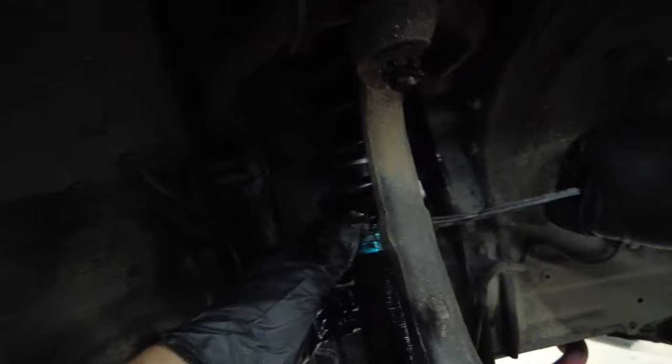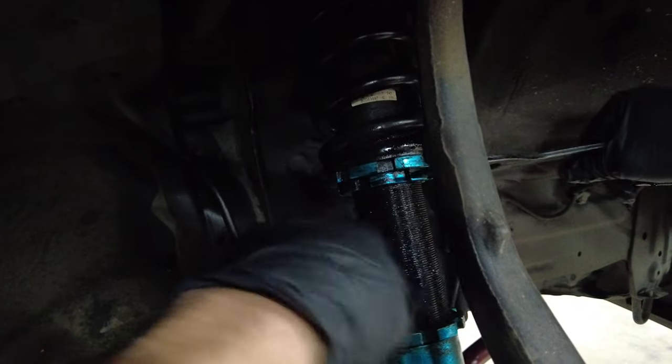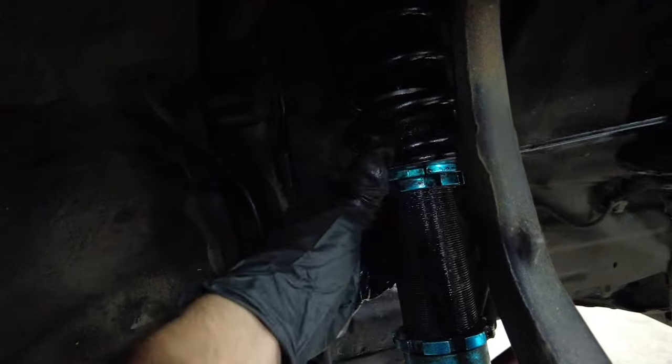Once that's about an inch up, and if you lube them and you take care of your coilovers, you can even, like, I take a wire brush to my super drift car, and I wire brush all this out and blow it out, because you don't want that crap in your threads. They get tight, and it makes it miserable to adjust. So we're going up, lefty-loosey, righty-tighty.